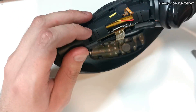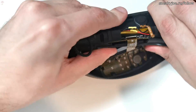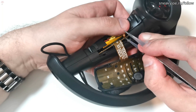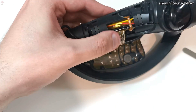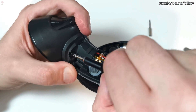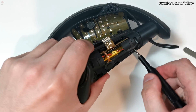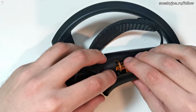It's time to finish the assembly. Remember to tuck down the red and black cables, and make sure that they are not laying on the battery. If everything is fine, use tweezers to fix and place the last small ribbon cable. It is way easier to do — just make sure to push the right and left wings. After that, I am inspecting the large ribbon cable to see if it's misaligned, but everything seems normal. I am wrapping the small ribbon cable inside the controller so it doesn't wobble. With this done, it's time to put our screws back. I like starting with the large one, because it holds the construction in place.